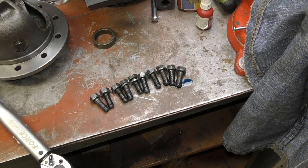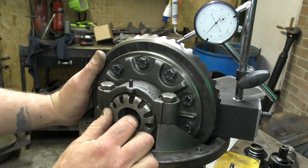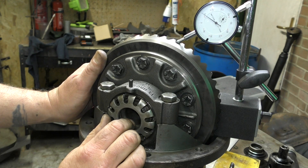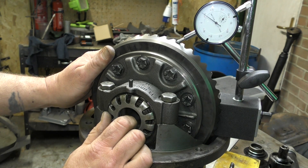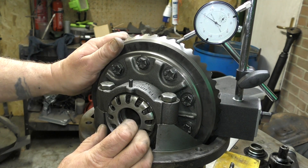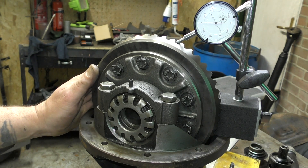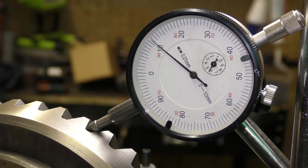Leave it for a little while and then do your job. The bearing cap bolts have been untightened. I've tightened the left-hand nut adjuster up, and now I'm tightening the right-hand one up. This is a little bit loose, but I'm just quickly checking by hand as I wind it on and off as a demonstration to show you how much this can go out. Now this is ideal — this is 0.10, and that's the exact backlash that you want. You can hold the diff flange pinion by hand and then just slightly move the crown wheel to get your movement. As I wind it in, this is not acceptable — it needs to be wider than this.